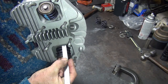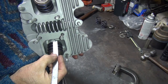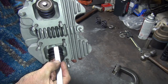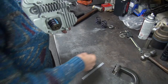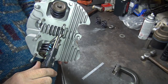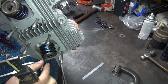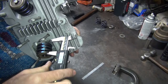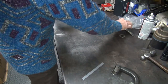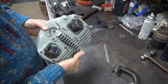This one here is definitely way up there, about 340. This one over here is a real tight three — it's right down here to 315 thousandths area. The problem with trying to use a vernier caliper in here after you assemble it is things are in the way — you can't get a straight shot. If you're not straight, you're not accurate. This one's really low, this one's real high — which is where it should be, because that's how we put them in.